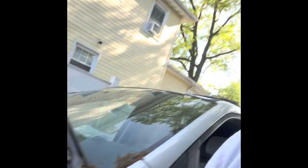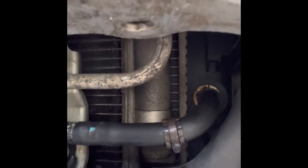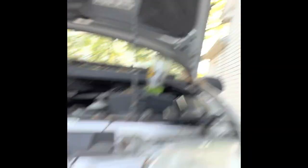But we got a little transmission leak, so now we're having a little fun with that. This is what we're up to now. That little clamp right there, the hose — got a lot of corrosion there, which I believe is making the hose pop out, making it leak. Once we clean this out and get this off, we'll put a worm gear clamp on there, should clean it out and hold pressure without a problem. That was harder to fix than this is, taking that damn thing out. So we'll see after we do the repair.